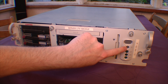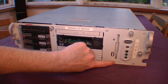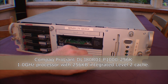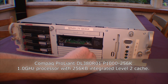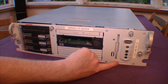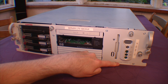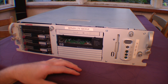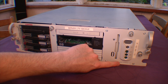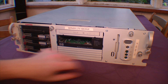On the front panel there's the on-off button, power LED, hard drive link, and activity indicators. Down here it says DL380R01 P1000 256 Euro. I think P1000 refers to the Pentium 3 processor at 1000 MHz, and the 256 is probably the amount of kilobytes of cache in the processor. We'll see when we check out the RAM whether the 256 refers to cache or something else.